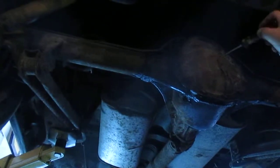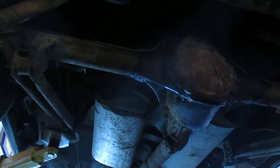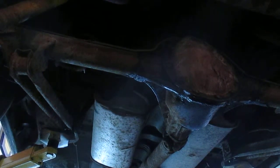As we move back here, it is a 12 bolt rear end. All the springs, the trailing arm brackets, and all the brake lines aren't showing any rust whatsoever. The rear end has got a little surface rust on it but other than that, it is a 12 bolt limited slip rear end. The tank appears to be original. All the bumper support brackets back here are also nice and solid. The bumpers are original and also in good shape.